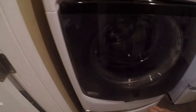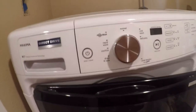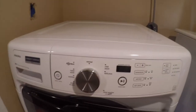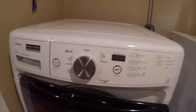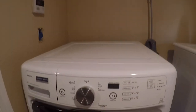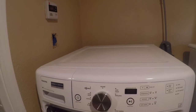First things first, I checked the filter which is strategically placed at the center of the bottom of the machine — you can see my other video for that — and that wasn't it. So the next thing on the list is the fill valves, because when I ran the machine after cleaning the filter, the hot water just kept running and running, and even when I unplugged the machine it kept running. I had to shut it off at the wall. Fortunately I have these easy to maneuver valves back here, but that could have flooded my whole house — all because a cheap part failed, probably because Whirlpool saved a few cents.